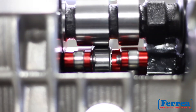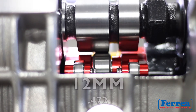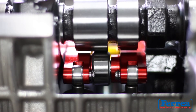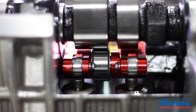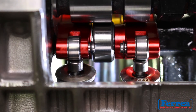This new design will allow you to go with a higher lift camshaft. The maximum lift we're giving you now is 12 millimeters — that's 472 thousandths — which is a healthy camshaft for this 2ZZ engine. That's going to give you a lot more horsepower and a lot more RPM throughout the engine.